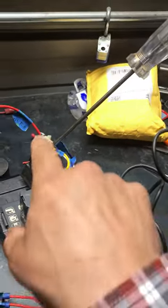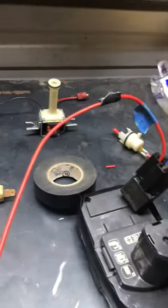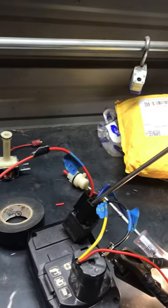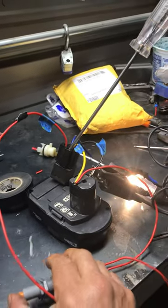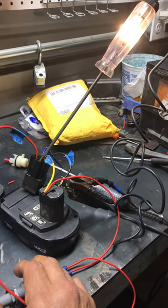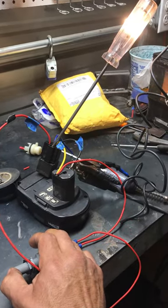I have it set up here so you can see it jump from 87A — the middle one, this blue wire going through that test — it's going to jump from 87A to 87 when I apply the brake switch. Your ignition is on, providing power automatically to 87A, so your torque converter signal is ready to work. When you get up to the right RPMs and around 65 miles per hour and need to stop, you hit your brake and it switches from 87A to 87, releasing the torque converter so you'll be able to stop. Every time you hit your brake it switches the power — that's how you wire that up.